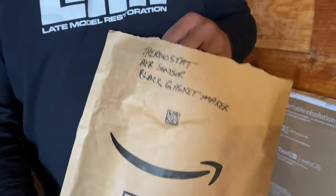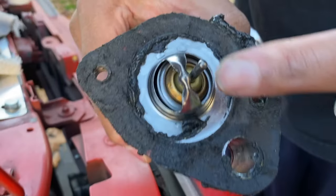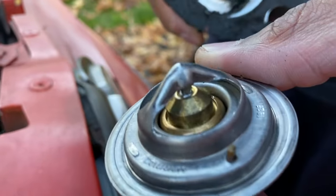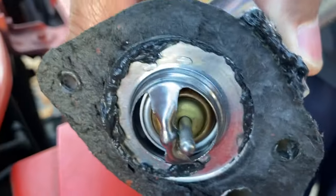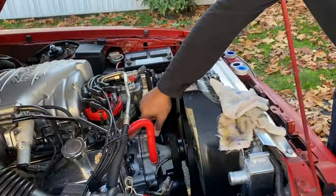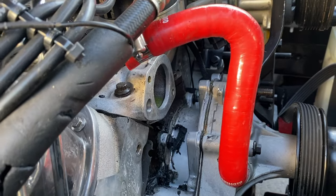Found the bracketry I need for the alternator. Found this pipe here. The one thing I needed was the thermostat — I couldn't find the one I bought from Amazon, so I headed back to the house. Success, found it. You see how this needle is sticking out to the side? This is how a thermostat should look — the needle's inside. This was literally no good. Anyway, time to stop complaining and get to work. I cleaned this mating surface off and scraped off the old gasket maker.